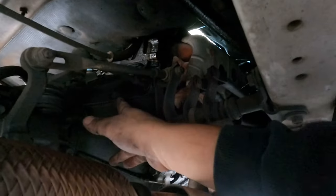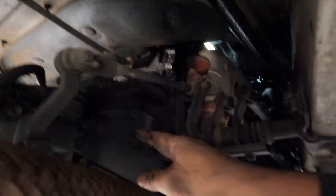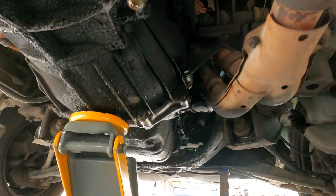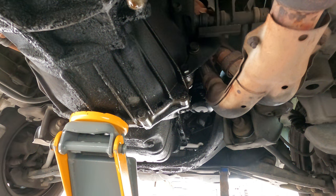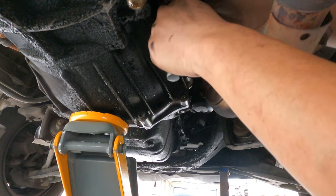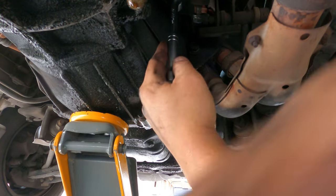Alright, you go to this side, and you can remove the bolts for the linkage. One, two bolts, and remove the linkage out, and it clears the way for the gearbox. So see the linkage holder, so one, two, three, four, five, six bolts, and remove that one on this side, and this one on that side, and the gearbox is free. For holding the linkage brackets, it's not easy to get them out. So number 14, make sure you've got the right tools.